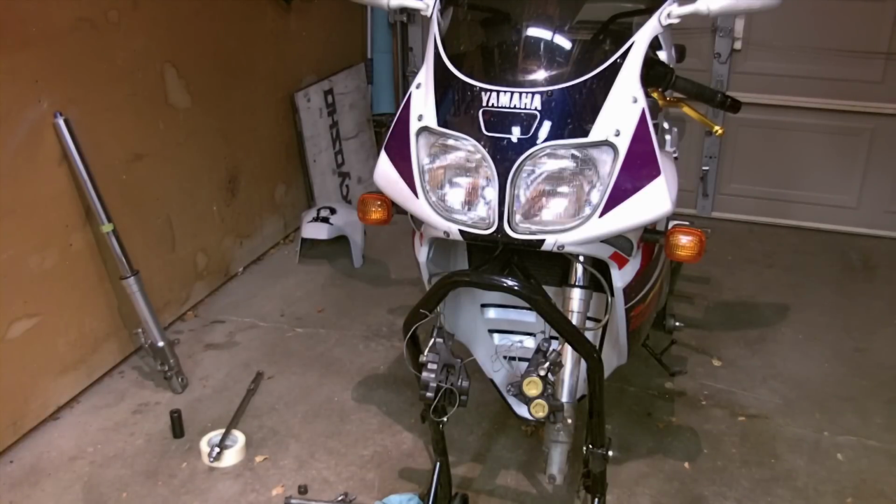I would also like to say that yes, I only had one leg leaking, and technically I could have replaced just the one. I would have saved some part money there. Well, yes, technically it'd be half as much money, although I'd still be buying the fork oil of both containers because I want the 7.5. However, let's say you're doing the slides, so they're $16, and then seals and dust was another like 12, so 30, say $40 is probably what you're saving parts-wise, realistically. It's worth doing both legs.